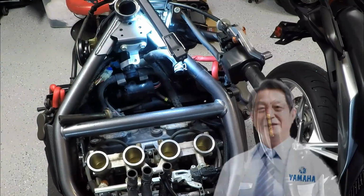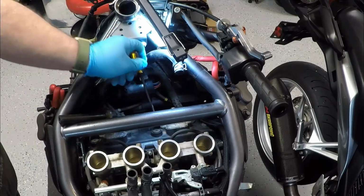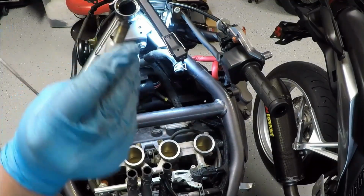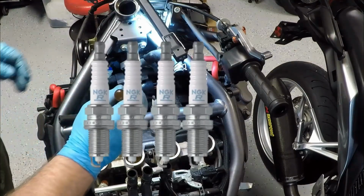It appears the valve cover had been removed and perhaps the valve tolerances checked, since there was some written labeling on the pair of inlets indicating which one went on the right and which one went on the left. The spark plugs were also changed, by the looks of it, to iridium tip plugs. The factory manual does not list iridium plugs as standard, and I'm changing them to regular NGK copper plugs anyway.